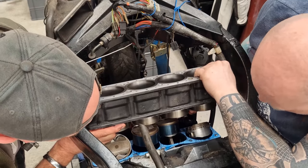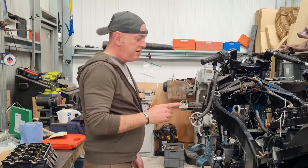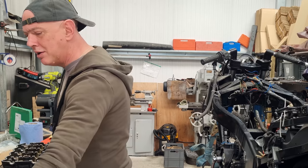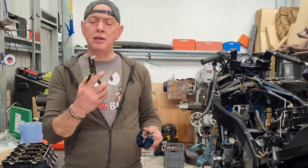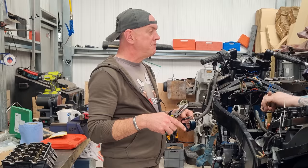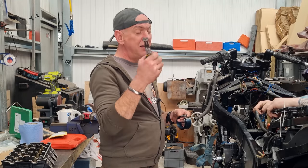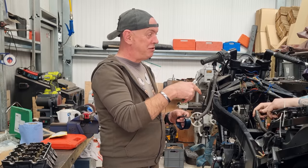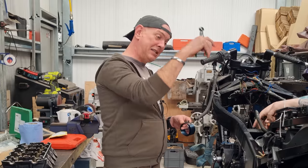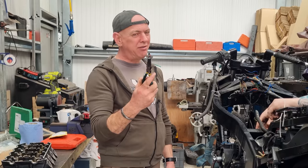Today's basically done and the barrels aren't on. I cheaped out and got some really rubbish tools — these things are junk. Firstly that bit isn't connected to this bit. And with this sort of bike there's two pistons up and two pistons down, so two have got to go in at the same time — you need a hand on each of these to squeeze the piston rings in, another hand to hold the barrels, hold the crank, and another hand to tap it down. I haven't got enough hands. Jamie's got a better version of the ring compressor.